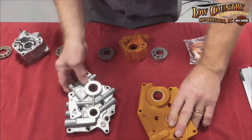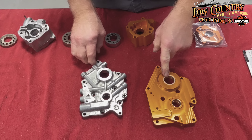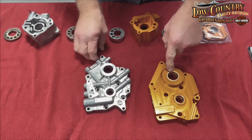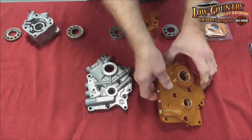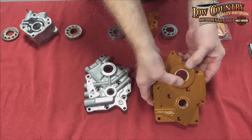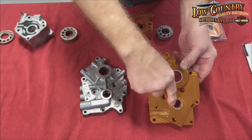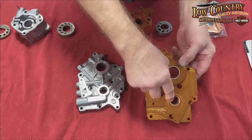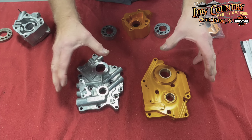We're also seeing the advantage of what the aftermarket people have done with bronze — 660 bronze in the pinion and in the cam journal area, which helps in lubrication. This large area also helps support the cam with high lift, and it helps in the resistance of drag from the cast aluminum and improves lubrication. So they've improved upon what you've already seen in other plates.